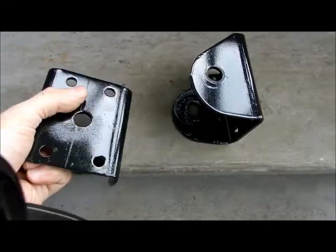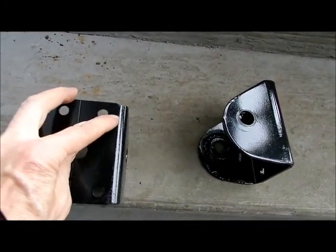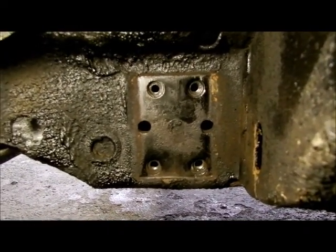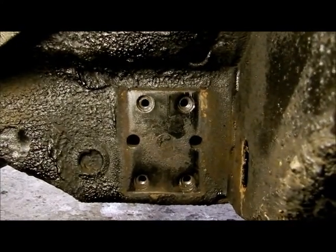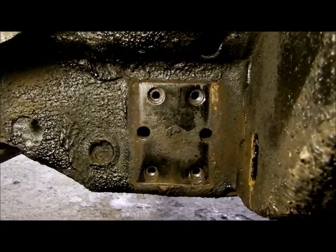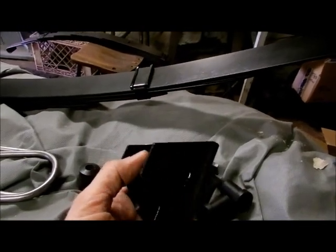Both anchors, when they have this angle side up, have the same hole spacing. This is the receiving area for the front spring anchor — this is what we're trying to get those four bolts to line up with. The hole spacing on the top is not the same as the hole spacing on the bottom, so the anchor cannot be reversed. The rear anchor is symmetric, so you don't have to worry about which side is up.